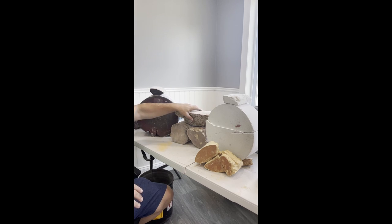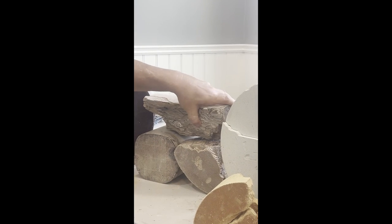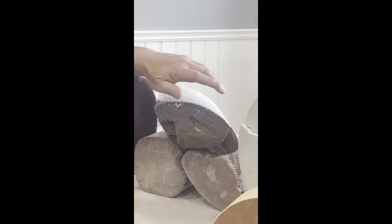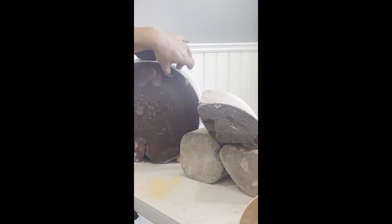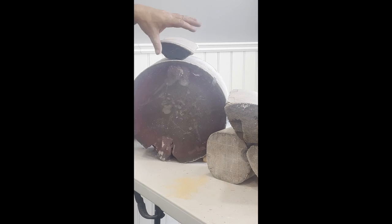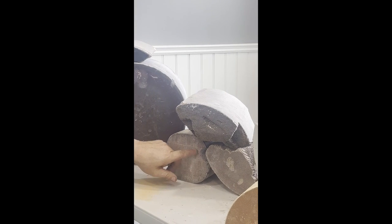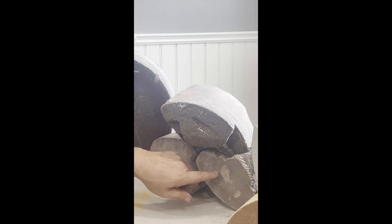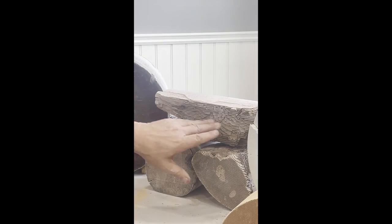Then you have the diesel filter. What you're going to see is different — every other hole is open on some of them. You see a larger flute size on the back than what you see on the sulfur or on the catalyst. So in the catalyst, you got real small blocks, always dark on one side, white on the other. The filter, you're going to see these odd-shaped holes, lines going through it every other hole. And if they're broken on the side, you see these zebra stripes.